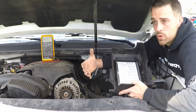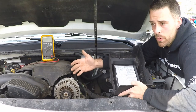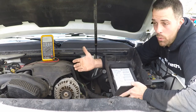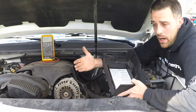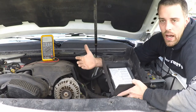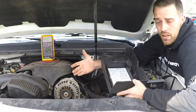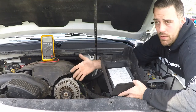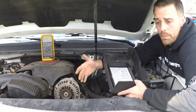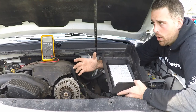So your amplifier is going to consume X amount of voltage, and it's going to consume an X amount of amperage, but usually they're rated in watts. So when we talk about watts, it's voltage times amperage. So we can figure out the amperage by simply saying, 1500 watts divided by how many volts you're producing during operation. It'll tell you what its rated voltage is, which is probably going to be 13.5. And so you just take that 1500 divided by 13.5, and it tells you how much amperage you would be consuming. So you're talking about 100 amps. That's roughly how much that system would be drawing to operate those big subwoofers.